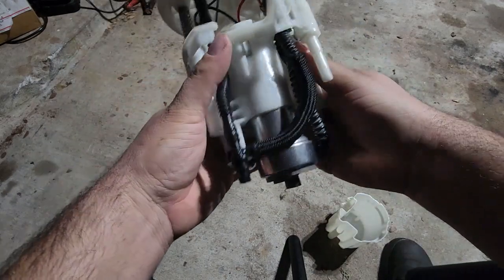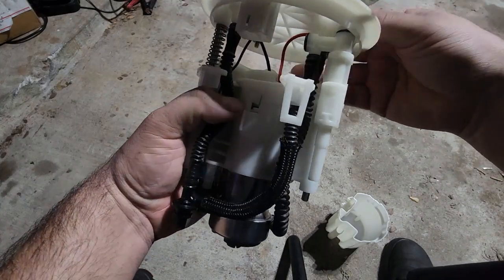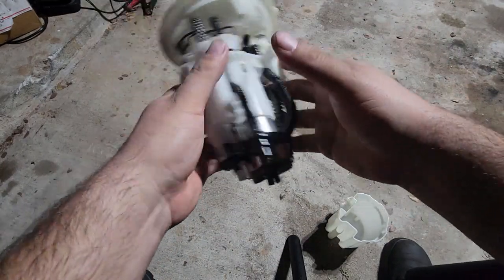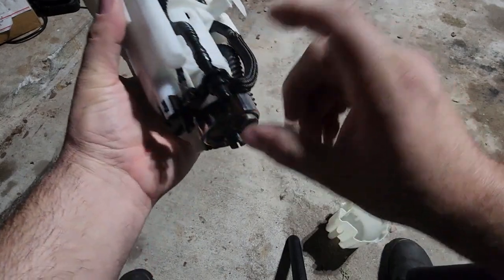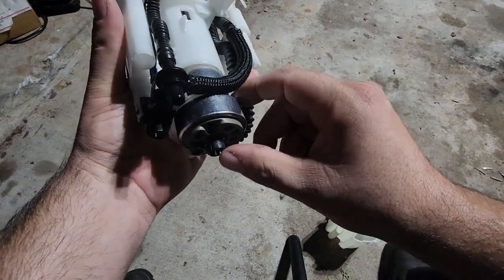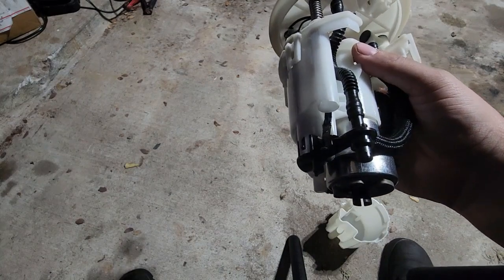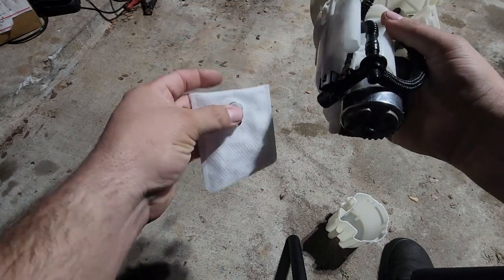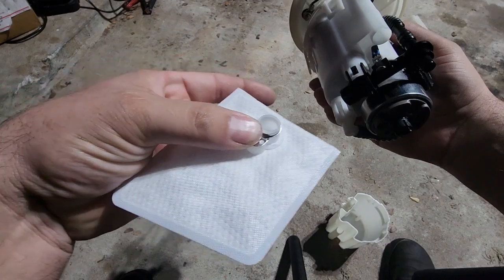to do. And like I said, obviously the two wires here are hardwired straight up to the pins here. But to me, this is the safer route. As much as I don't want to damage the pump by having debris come in here from the fuel, that's going to be a lot safer, to me personally, I mean, everyone's entitled to their own opinion, than pinching down this filter and having the pump try to suck through these very small holes that are inside here.